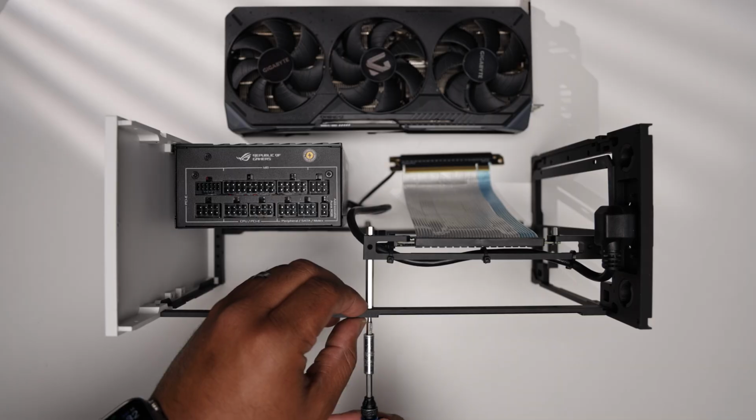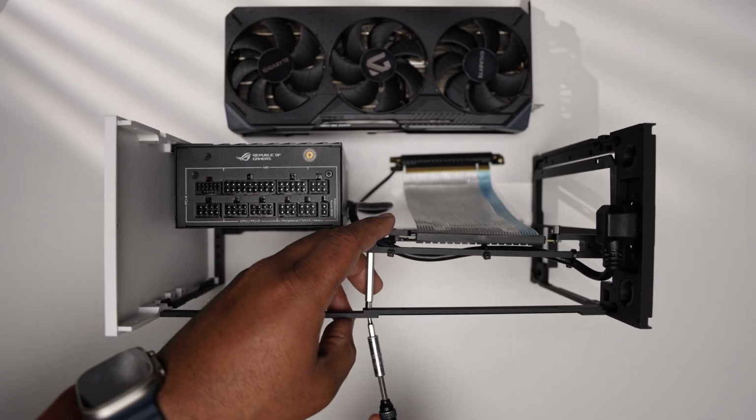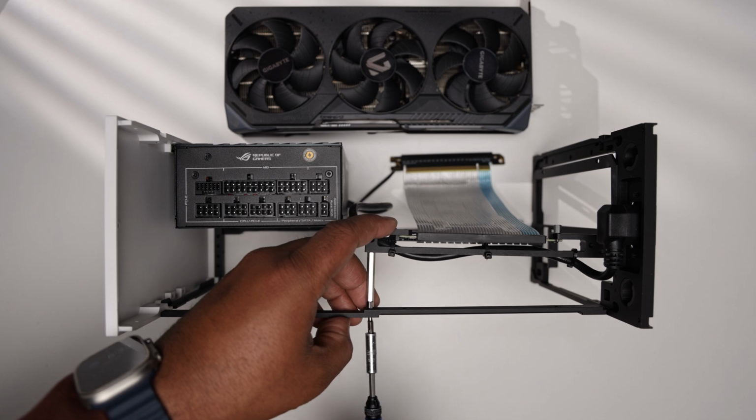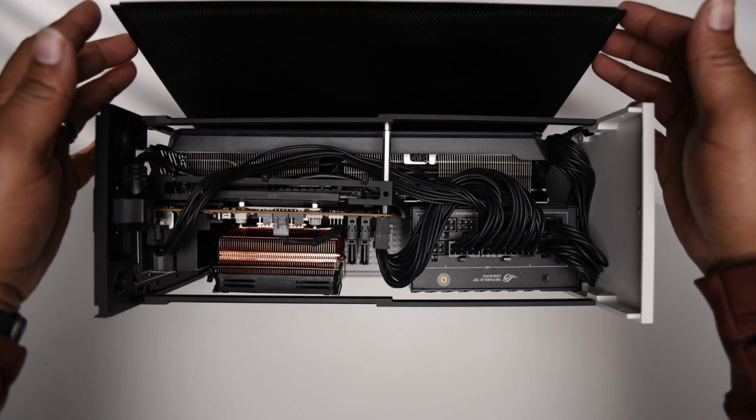To install the card, you need to first set the T1 up in the 3-slot mode, or the 3.25 slot mode if you have space. You may need to add a 5mm standoff to the riser bar for a total of 40mm. The fans protrude about 1mm above the shroud. This causes the fan to clip the side panel, something you really want to avoid.